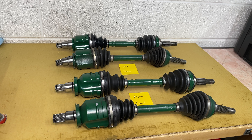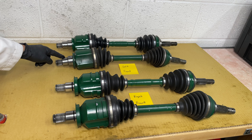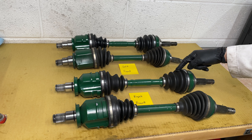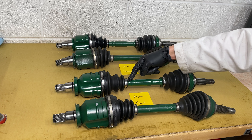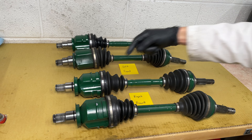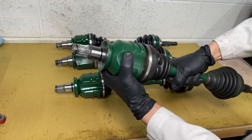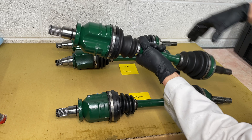Let's compare the front CV axles. The right side has an O-ring on the part that goes into the transfer case, and the left side has no O-ring but has two steps instead. The AutoZone CV axle has many ridges on the outer CV boot, and the Toyota has three. The AutoZone shaft is smooth in the middle, and the Toyota shaft has some ridges. Also notice on the AutoZone CV axles, some of them have ridges for easy removal and some do not; on the Toyota, they always include that part. The AutoZone axle didn't develop any play on the inner CV joint, but has a bit of play on the outer joint. The 24-year-old Toyota part has no play.